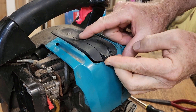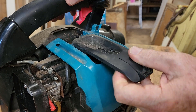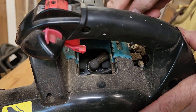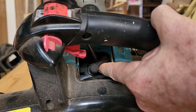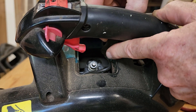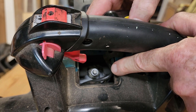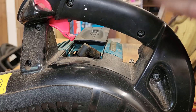The spark plug is accessible under this cover — we lift that tab up and slide it back. The spark plug boot is just down in there. I'm going to take the spark plug out to have a look at it because the condition of the spark plug will tell us a bit of a story about how the engine's been run. Looking through at the cylinder it looks nice and clean — there's no buildup of dry grass or leaves, which is very important on an air-cooled engine.